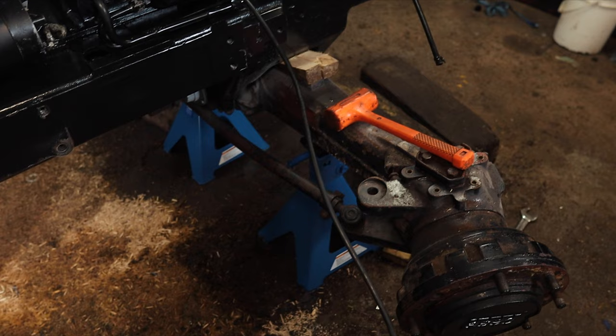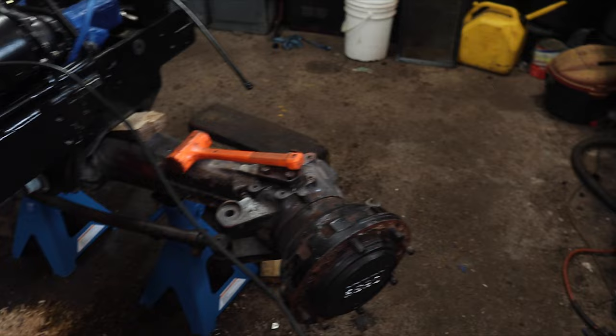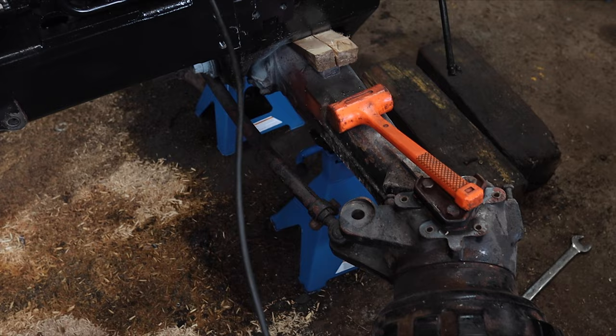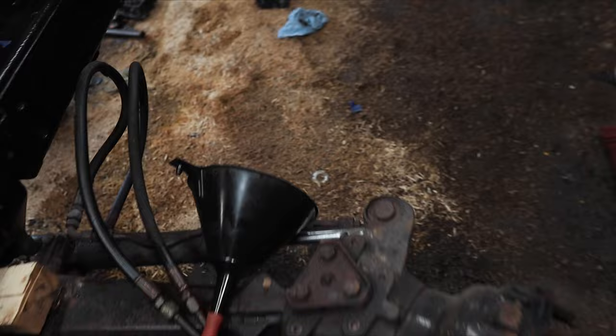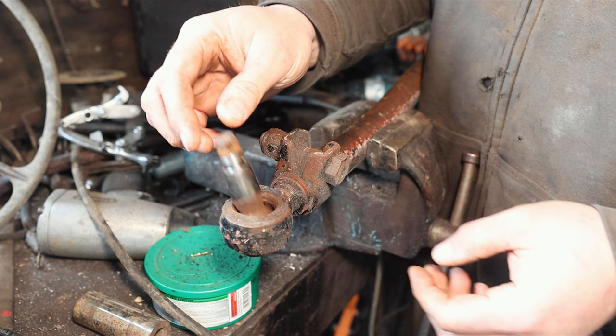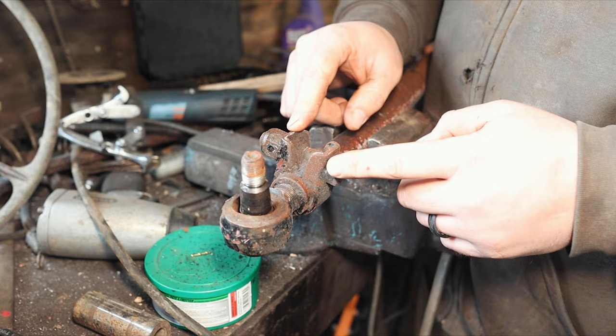Since the last video I did buy two more of the same jack stands I had for the back and put them under the front there — they're not as spread apart as I'd like but I have to have somewhere to jack it to, so it's plenty stable. We will deal with that track bar next — we might have to do the steering first, but the steering isn't in the way of the track bar, so we'll do the track bar next. The old end shows there might be a little bit of steering play caused by something like that.